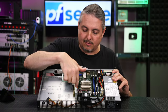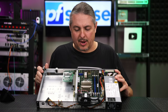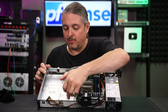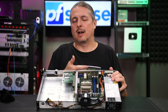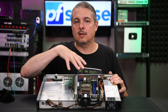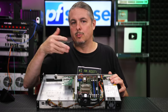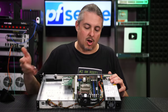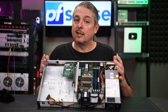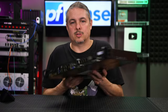That is just so we can easily show the board and everything in here, which is pretty basic. We have 6 SATA ports on board and we'll dive into the details there. The reason for them is it's still a standard motherboard, but if we wanted to add some extra hard drives, there are certain special situations where you may want some extra logging configured. I've talked about this on the channel before - building a PFSense system with some extra storage dedicated towards logging. It is kind of an edge use case, but they do leave a little space in this chassis, and this being one of their higher-end models, maybe that's a use case for anyone who's installing one of these.